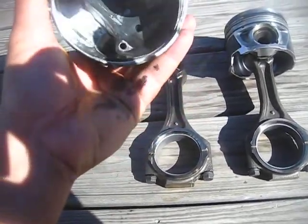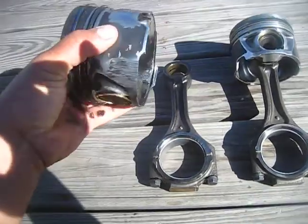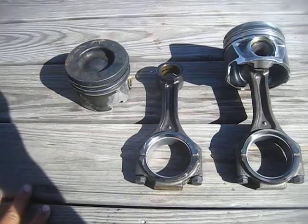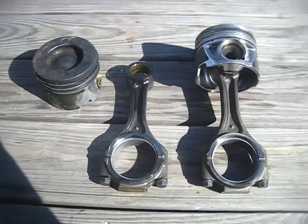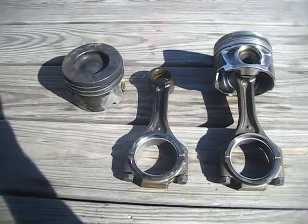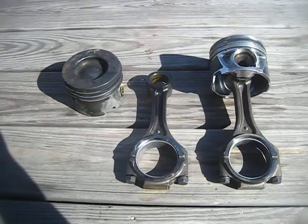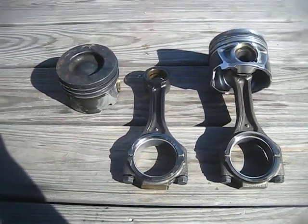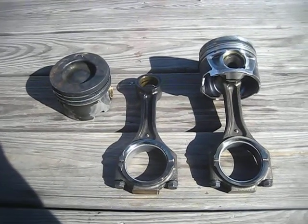And these pistons, they don't like heat, they don't like high boost and high cylinder pressure. That's all from boost. There's guys out there, I mean, it's sad to hear guys shattering their LBZ pistons with a stock tune. It's just horrible, the design that they did.